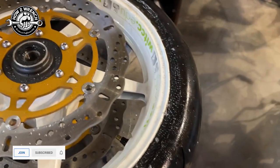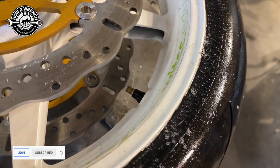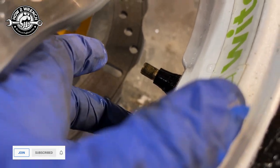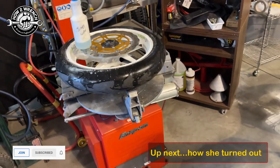And ultimately, last thing: do not forget to check your valve stem itself as well. Make sure that it's not leaking around its base, and also on the core itself. The best way to do that is tip the wheel up and down, and then check it that way.